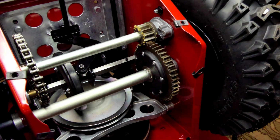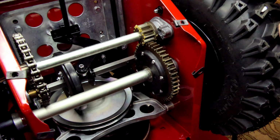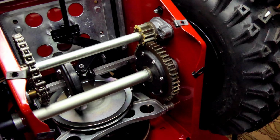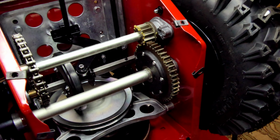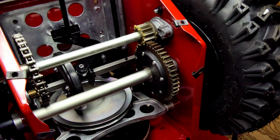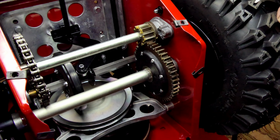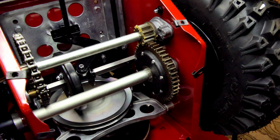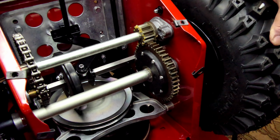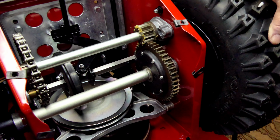I just want to say a little bit more about the automatic steering. Between Toro and Ariens, I would guess there's probably 300,000, maybe 400,000 of these units out now blowing snow and clearing snow. The auto turn is put in small units, as small as a 24-inch, and all the way up through a 36-inch snowblower. And there's really no problems with them. So when you read or hear someone on YouTube complain about the system, most of the time they don't have the skid shoes adjusted properly, they have one tire that's flat, or they have an old original 2014 Ariens. You just don't hear any problems.